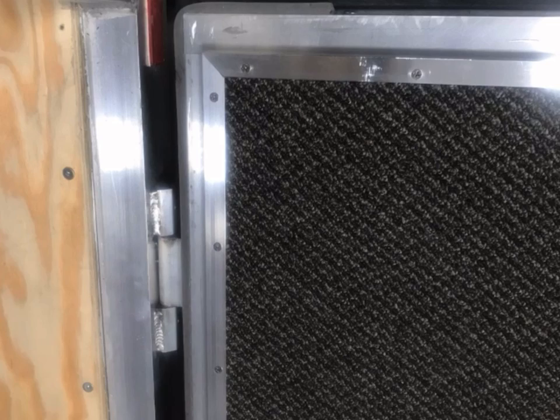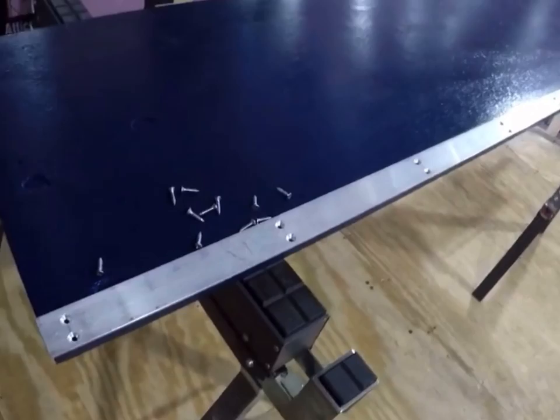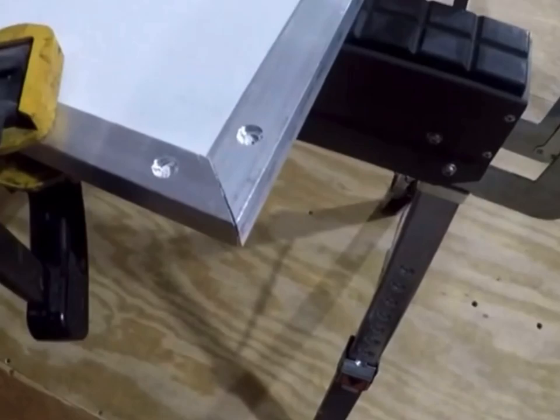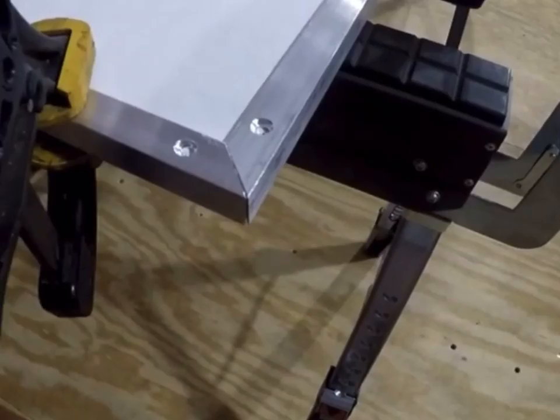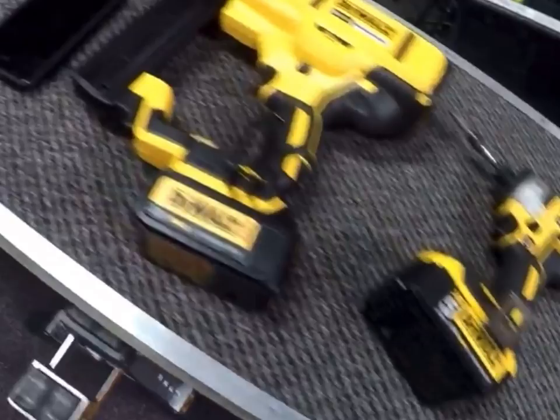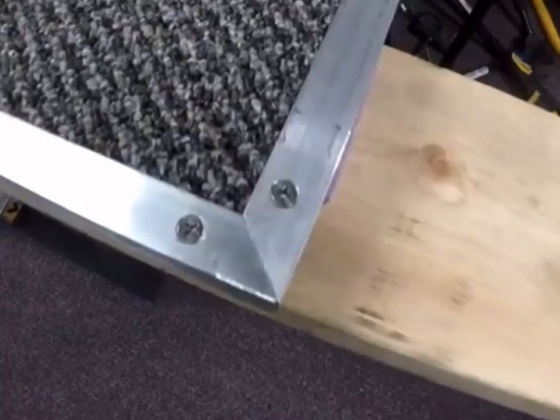I installed the aluminum after the carpet was on using an ice pick. Here's the rear flip gate — I painted the inside blue. That aluminum strip on the edge is the part that contacts the ground. If you can cut a 45-degree angle decently, it's pretty easy to wrap these boards with aluminum. That's what it looks like before the carpet goes on. I use clamps to crush the aluminum tight onto the board, then use an ice pick to line up the pre-existing screw holes. As you tighten it down, everything pulls real tight and the 45s look good.